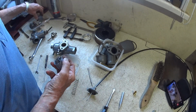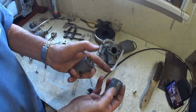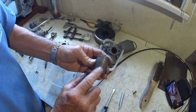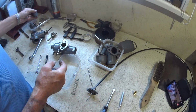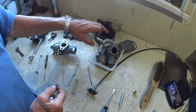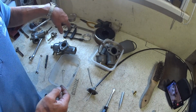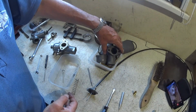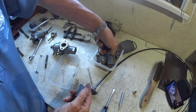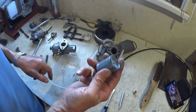The others were very worn, in fact so worn. If you look at this little cutaway here, on this one it was so badly worn, it's worn through the depth of the cutaway. And I can't use the one off the B50 because that one is a 930, so that'll be 30mm across there. And there's a slightly different profile, because obviously when this opens up fully, that radius is supposed to match this radius. This one's 28, obviously a 928, and that's a 930, so it's going to be this one.